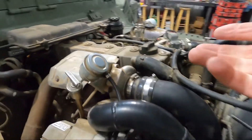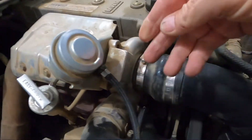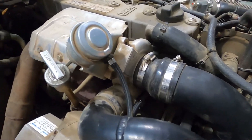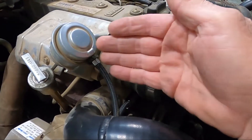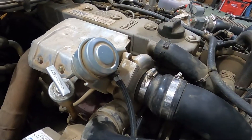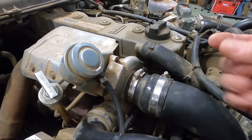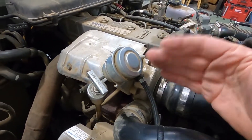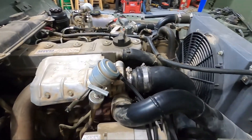I even tried taking the line off the wastegate valve and hooking it right to the intake — like on a Caterpillar C15 engine where it's direct. So whatever the boost is, around 15 psi, that's when it opens up and as soon as boost decreases it closes back up, keeping a steady state of 15 psi. But this engine is not set that way. We know the dashpot for this wastegate opens up somewhere between 7 and 15 psi.